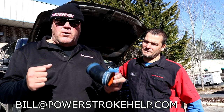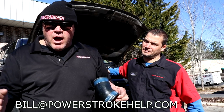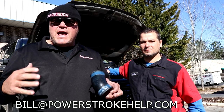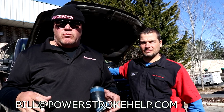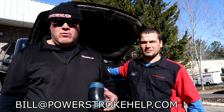And, you know, you're running, making 10, 12 pounds of boost. Diesel's just singing, and all of a sudden, pah, and the thing will just fall right on its face. Diesels need boost. In other words, you've got to have air molecules to mix with the diesel fuel molecules in your combustion chamber, or diesels simply don't make a hell of a lot of power. Normally aspirated diesels just are total dogs.